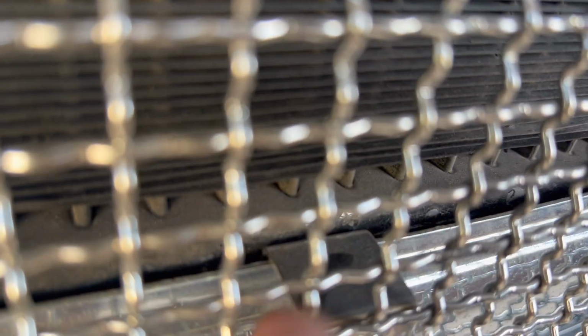Okay, once you've got everything fit, there's a little clip that you can maybe see between the stone guard that rests on the top of the radiator shell inside there. Look at your grommets. They are not terribly squashed, so I think our estimate was right on. Other one on the other side. By the way, I've got this perfectly lined up on the edges, all the way up around the top. That's centered, and all the way around the side. You want to get it pretty close, and then you can put your bolts in here and start your final alignment right there.